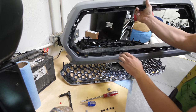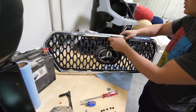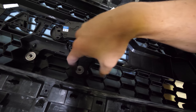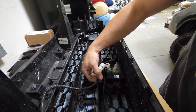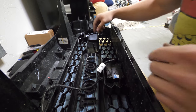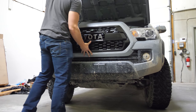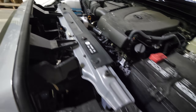We want this portion, so we're putting this other plastic frame into this one. It looks like we have the black plastic and then the chrome portion. We've got rid of the chrome portion and now it's just solid black plastic all the way around — I like that better. For the radar sensor I'm going to put it in this screw hole. It clips in. There's one plastic clasp at the top of the radar housing and one on top of the grill as well. All of those black screws we took off aren't needed with the new grill — the back is just held in by those clasps, which isn't as secure, but so far it's staying on.